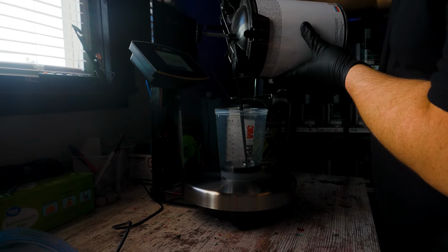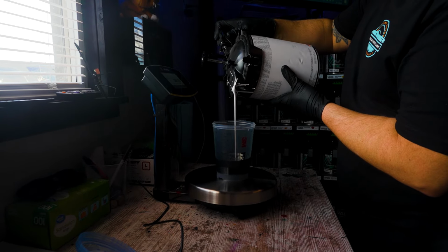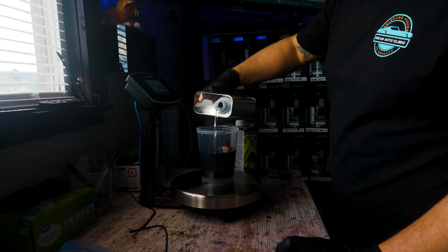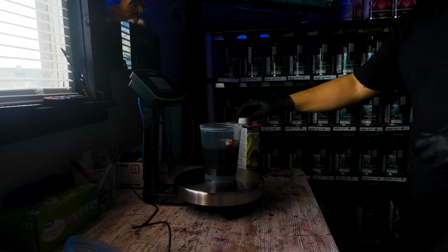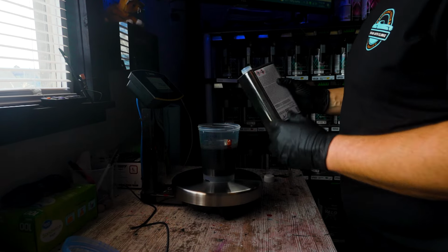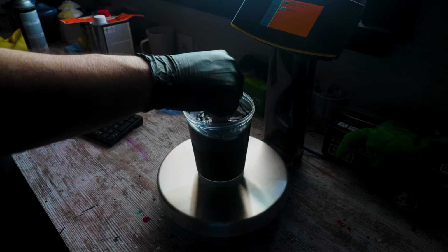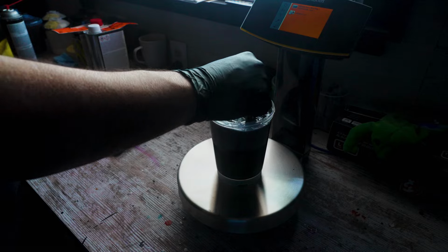On this car, we're going to use the Valorum 300 series sealer. Pretty neat product. You mix your gray shades, or you can do white, black, whatever you want to do, pretty much. Works really good. Levels out real nice. Dries good. All around solid product. This vehicle calls for an undercoat 250 shade, which is kind of a darker gray, and it causes the red to cover a whole lot better than going over a traditional white or something like that. The pigment and everything just really reacts great to the darker undercoat.